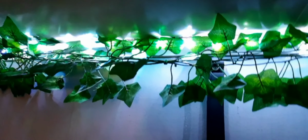And I wanted to add the reason why I wanted to reseal the roof, even though I'm going to be redoing the inside of the box, is because I have had leaks, a few of them, like see right here where this sticker covers up. Also, if you look right here, you can see it's leaking from behind those ivy leaves there. It leaks down the wall. And so that's another one that had just happened. So it's a good indication for me to reseal the roof. So that's the first step, and that's what we're doing.